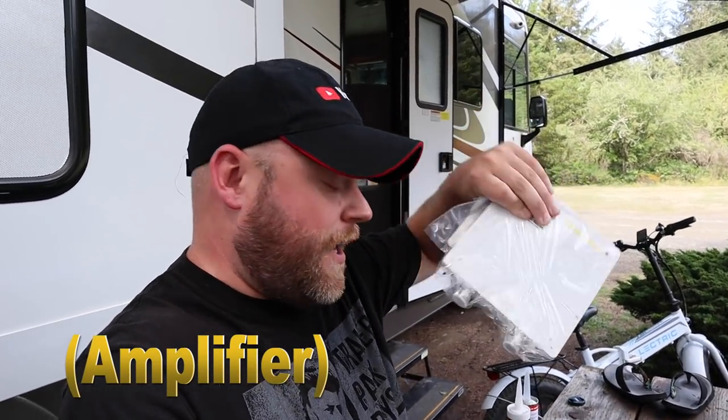Essentially what we're doing is, instead of going directly from our phone to the cell phone tower that's really far away, we go from our phone to this interior antenna, which goes to another module — in this case this white one will be outside the RV — and then this big antenna is up on the roof, which communicates with that distant cell tower. This device amplifies that existing cell signal and gives us a more workable cell service. It does not magically give you cell phone service if there's no tower nearby; it simply amplifies what wasn't usable into a usable cell service.